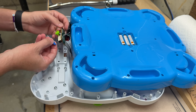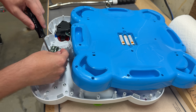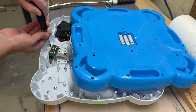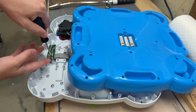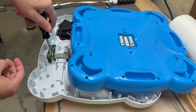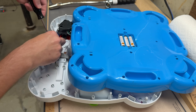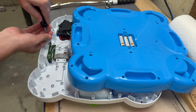I need to make sure this is on — I think it just goes on like that. Then I've got these two screws. Another cool thing about this toy is every screw in here works with the same screwdriver. Even little SBC things that you'd think would use the same screw for everything don't do that. Nice job to whoever designed this. Whenever you're putting back together something that uses plastic standoffs, I always go back a little bit until I feel it starting, then begin screwing in — otherwise you'll form new threads in the plastic and wear it down. Similarly for 3D prints — you don't want to re-thread them once you've threaded it one time.